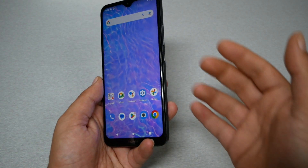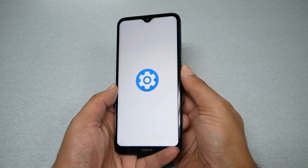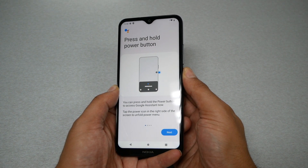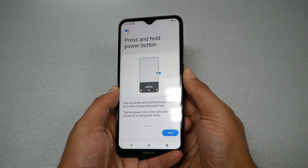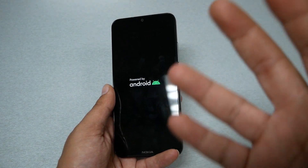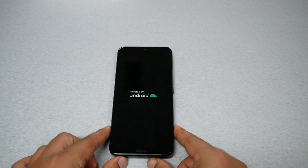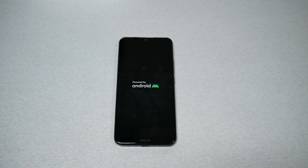Let's go ahead and do it. Even if I don't have an issue, we should be able to do the same thing. Press on the power and hold until you feel the phone vibrate, then immediately remove your finger from the power. The estimated time for the process is 10 seconds. The phone just vibrated in my hand — I'm removing my finger from the power and the phone is now restarting. Hopefully you just have a glitch or a frozen screen and this will fix the problem.